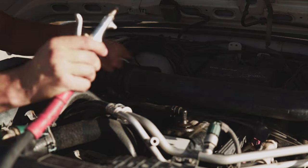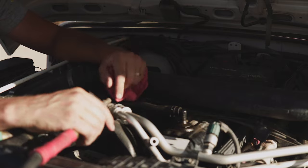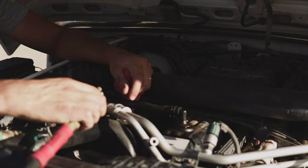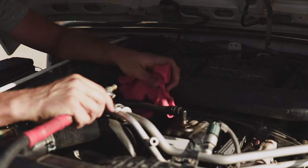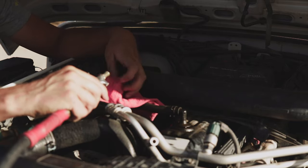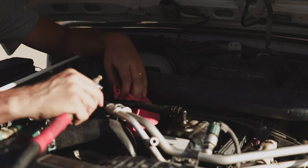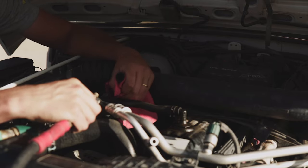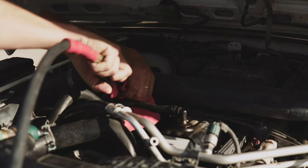Here is the trick — you need an air compressor and a rag. We're just going to blow compressed air through everything. Word of advice: turn your compressor down if you can. I have mine set to about 25 PSI and I really don't want to go much higher than that. You don't want to risk blowing anything out. These systems aren't rated for much pressure — about 15 PSI is all — so you really don't want to throw 100 PSI through here because that's a sure way to blow something out.